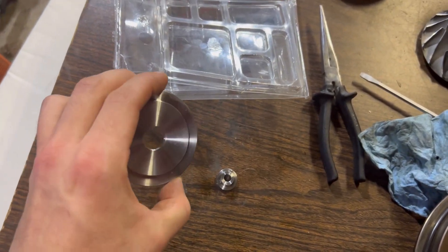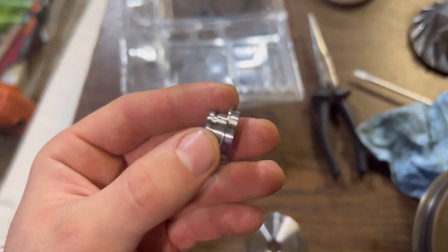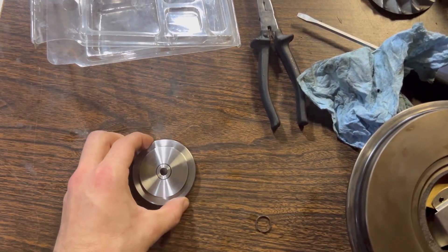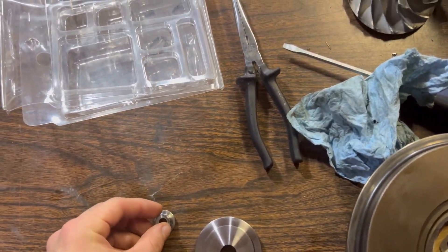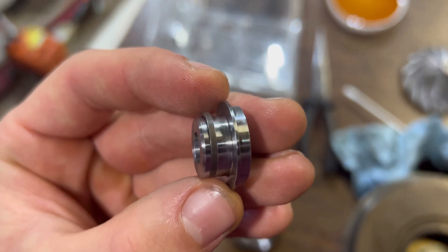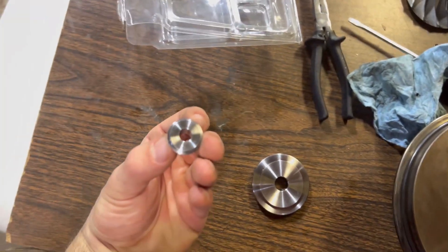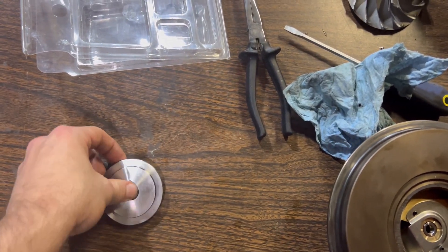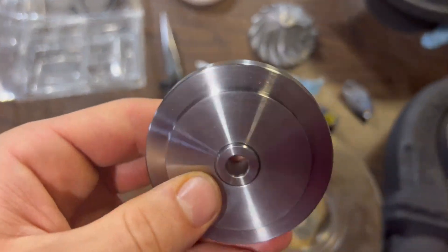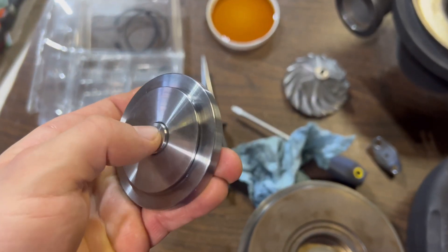Next you take the oil seal plate — the kit comes with it, though you could use the old one if you wanted — and then the oil baffle. These two actually connect together, but you just need one thing: a snap ring kind of like a piston ring, and it goes in the groove on the oil baffle. That's what it looks like when it's on there; it's kind of loose and that's normal. Then put those together and press them in — they snap together. Once snapped, that's how it's going to look. You will hear a snap when it's fully in. It moves a little tiny bit, but not much.